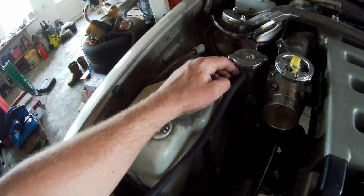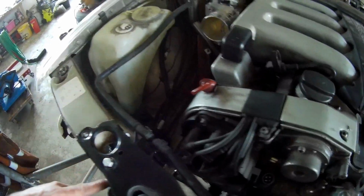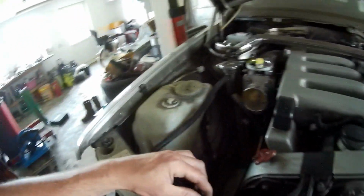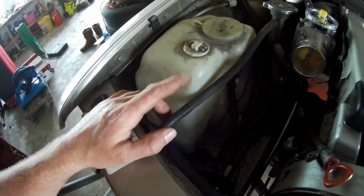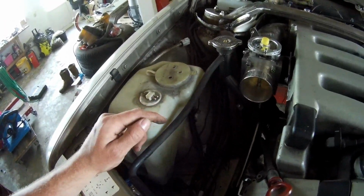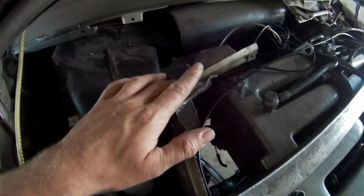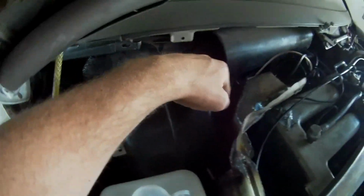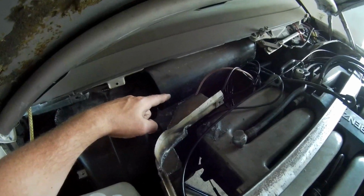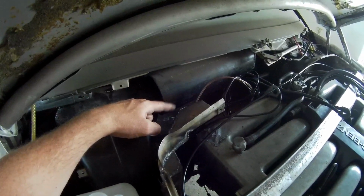Then I got a second pipe that's going to the top of the engine. This piece is original, and to the radiator, that's all original. From here, this is an original pipe. Sorry about the camera angle. I cut it here with a new hose in it. It will fit nice. It will be all tightened up when it's going in there for the last time. Then it's going through the firewall panel, or the separation panel. I only have to mount in here to the heater, but it's not reachable with the engine in. Yeah, I can do it, but it's easier when the engine is out. So the last piece I will do later on.